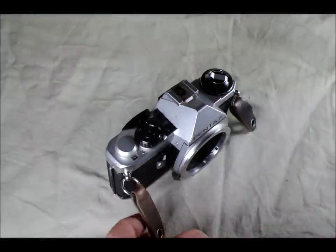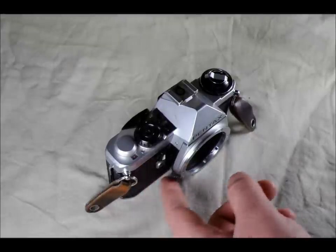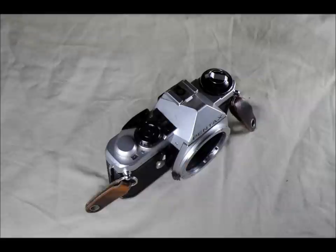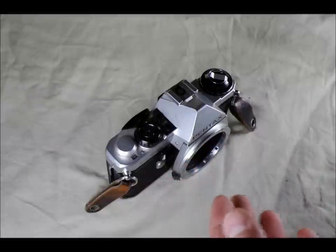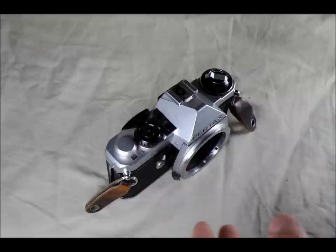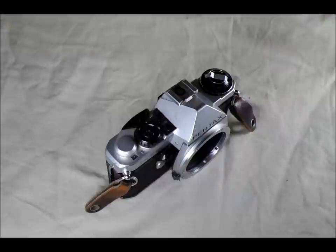Don't leave your camera and lenses in your car, because heat damage can cause lubricating oils to seep into places they shouldn't be, re-solidify, and cause the camera to not work properly — same goes for the lenses. Don't store your gear in a plastic bag or case, because moisture will get in and you can get fungus, which will etch the glass or get into the mechanism — it's very damaging for lenses. Don't let your camera get wet; this is an old entry-level camera with no weather sealing, and it has many electronic components that if wet will short out, with no replacement parts available anymore.